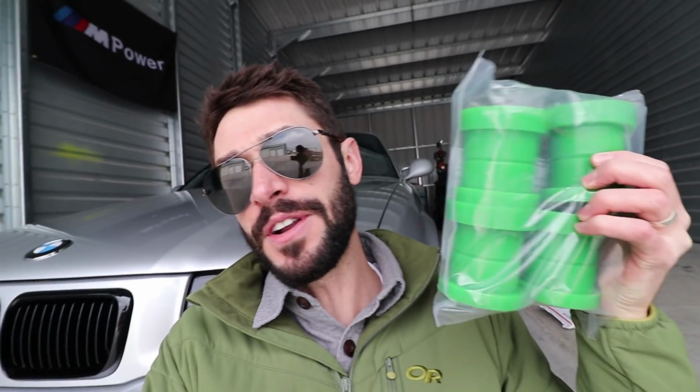And I feel like it gives that a little bit more of an opportunity to put more stress on the metal than is necessary. But I also didn't want to go with the stock softness of the rubber bushings, although those offer the best NVH. So I figured I would go with these 95A polyurethane bushings because they're kind of a happy medium. They're going to be stiffer than stock, but they're also going to absorb some of the shock.